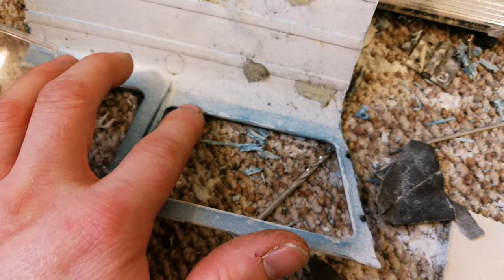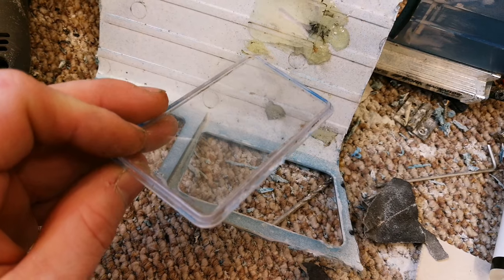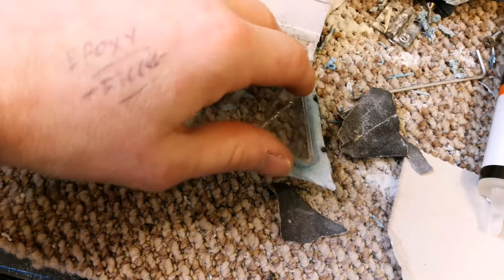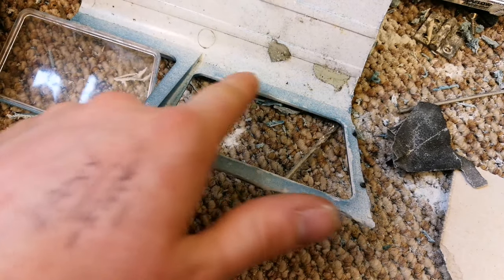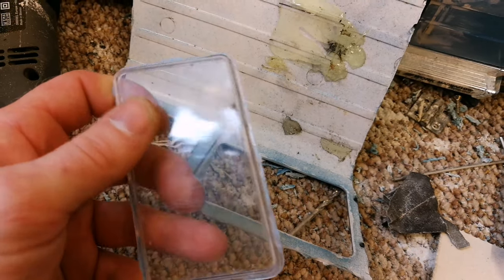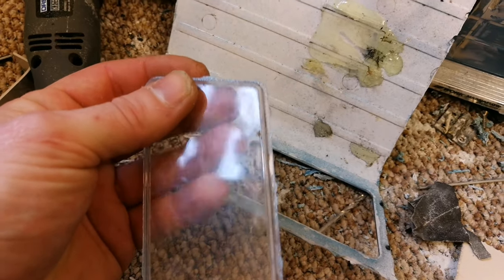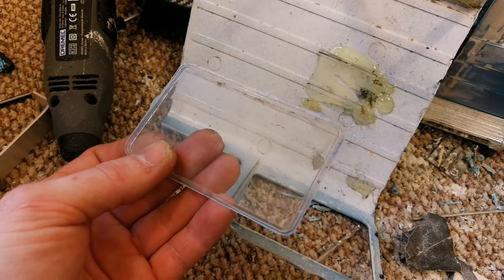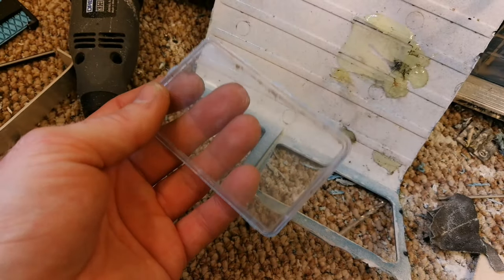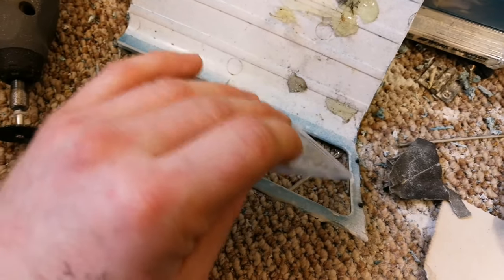Go and scuff up - key - your inside area where your window frame is, where your bead of glue is going to sit. Scuff up this area before you put any glue on. Be very careful when scuffing near the polycarbonate side, because you can't really polish polycarbonate - it tends to scratch no matter what. If you put marks on it with 80-grade sandpaper, it's likely going to be permanently marked.